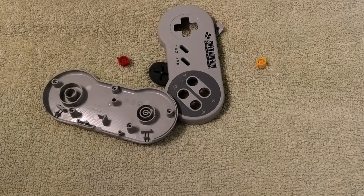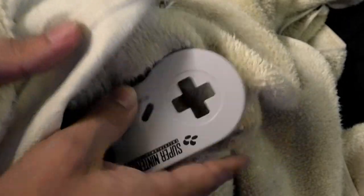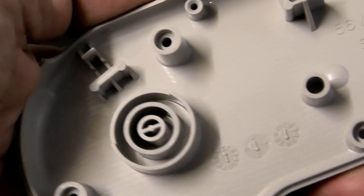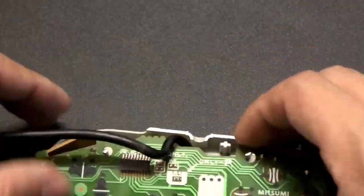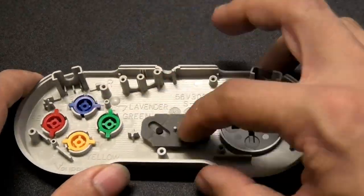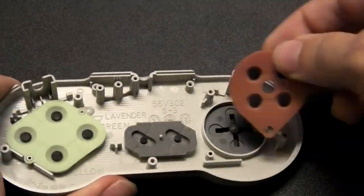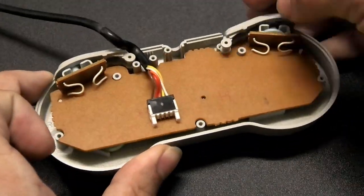When you are convinced that all is well and cleaned up, place it all on a towel and either let it air dry overnight, or be impatient like me and manually dry it yourself. There are always difficult bits, such as the screw posts, where it'll be a little while before they're completely dry. But hey, once it's all clean and dry, and make sure it's completely dry, you can put it all back together. Just reverse the teardown procedure and make sure you don't lose those finicky pieces.